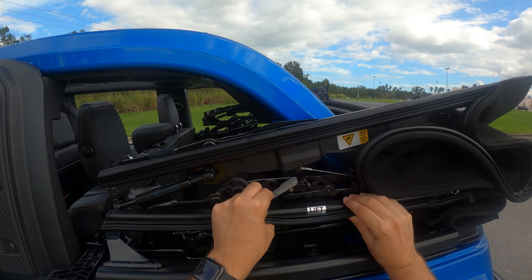I hope that first part of the tutorial helped you on taking the soft top down without the windows. Now let me show you how to put your soft top back on — it's the same procedure, pretty much reverse engineered. Press down on the lever, make sure both sides are unlocked, and lift. As we put this back down, watch out to make sure nothing gets scratched on the roll bar — you want to do the same thing going back. Pull up and make sure none of this touches the roll bar, otherwise you'll get scuffs and scratches. Gently nudge it in there. Both sides are good.